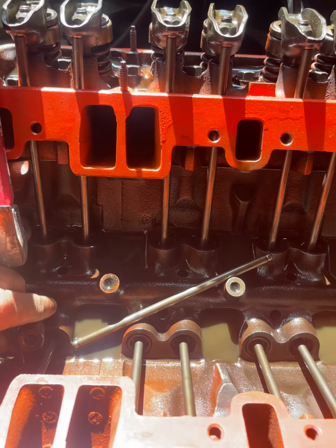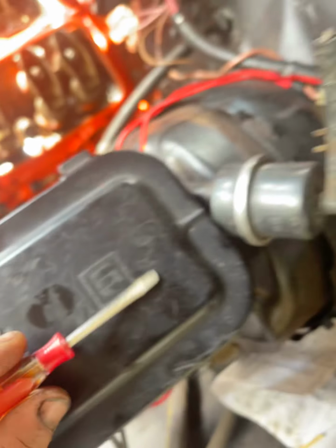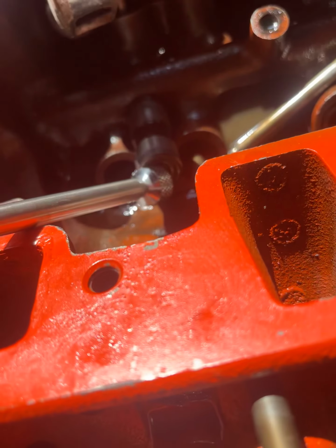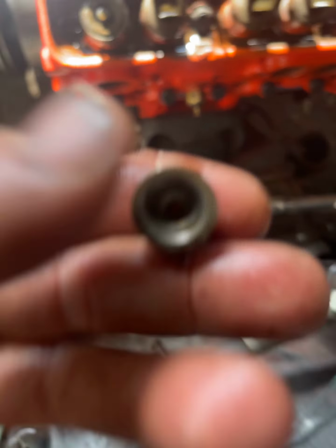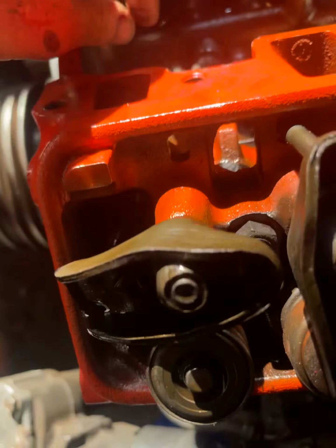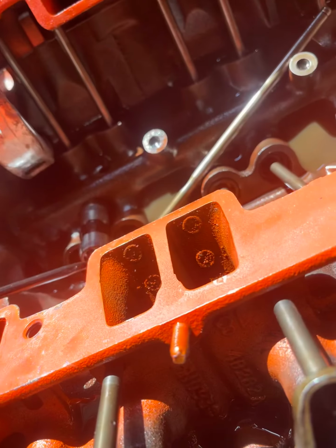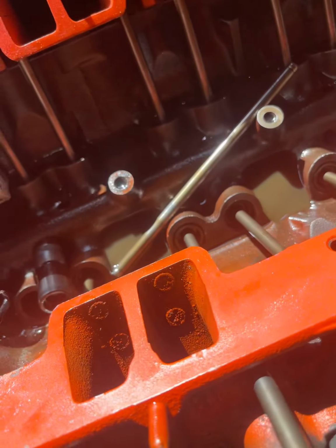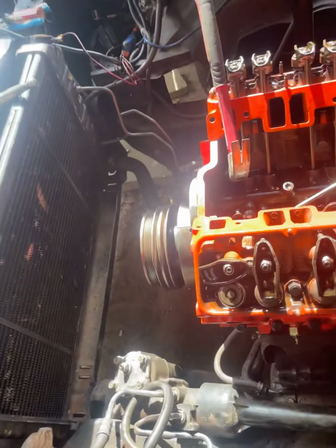So what I do is I take off the little lock spring with a small flathead, take this off. Then with a magnet, we fish this out. Okay? Alright. Now remember, the lifter's stuck inside that hole. Stuck. So what I do is I use this tool to bring it up some. But then it gets stuck in the bottom. And what happens then?